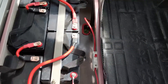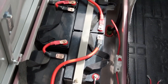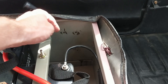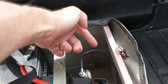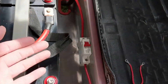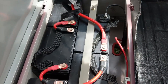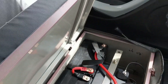That kind of shows you how wimpy the power system is in this car, stock at least. The cool thing is I discovered that you can easily fit six of these big 55 amp hour 12 volt SLA batteries in here. But make sure you take an angle grinder or something and cut off the self-tapper screws they use to hold on the shifter — they just leave them sticking out in there. It's not really a problem for the stock batteries, but these screws were left long and I would cut them off too, because you don't want batteries sliding forward and puncturing them. I'd recommend putting some foam on top of this whole thing so it keeps them from bouncing around, and if they ever bounce up you don't want them shorting out on the metal seat plate.